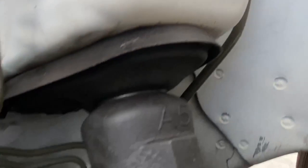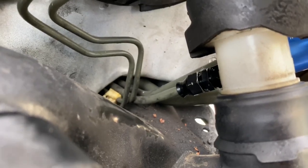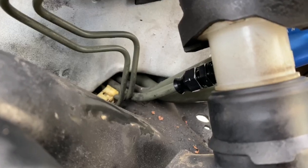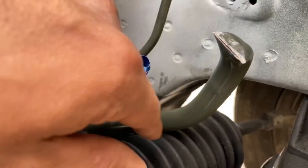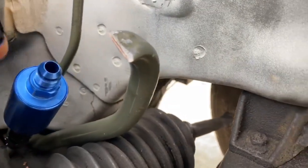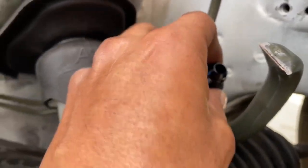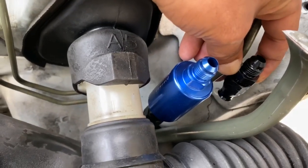I left it a little bit lower because of the way it's going to line up with the return, and I'll show you guys once it's on there. I got the fuel filter in there with the pressure fitting. The reason I cut it a little bit lower on the delivery side is because we're going to add the fuel filter, so the distance in between would have made it a little bit awkward. I left the return a little bit longer so it'll kind of match up, and both of them are going to be sticking out in the same place.